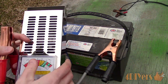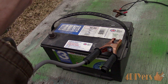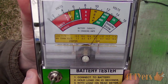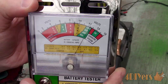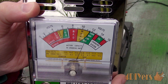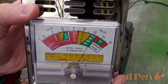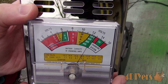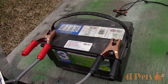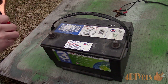Connect the clamps to the appropriate battery posts just like before — black for negative and red for positive. The meter will automatically work once hooked up and we can see the current charge, just under 13 volts, using the needle and scale at the top of the gauge. Now pressing the switch — this is a momentary switch so you need to hold it in place for 10 seconds. Monitor the needle as it will most likely drop. With the battery being 875 cold cranking amps, watch the needle reference in the green stepped area at the 900 value section. The needle does drop and falls into the yellow section, meaning the battery is on the weaker side.